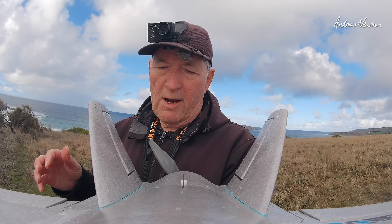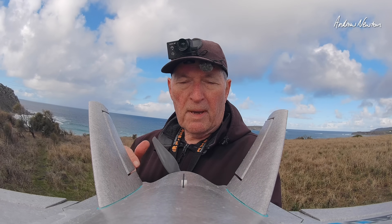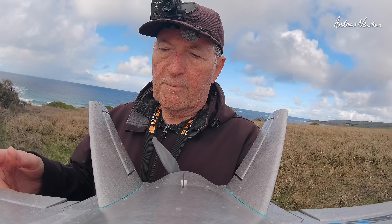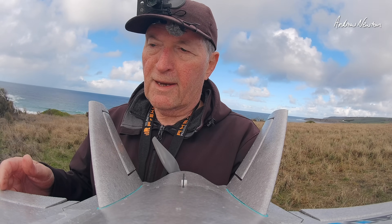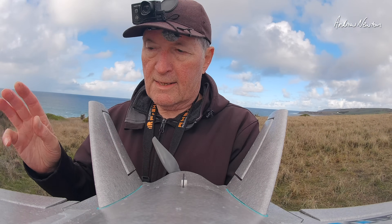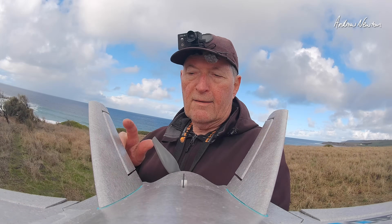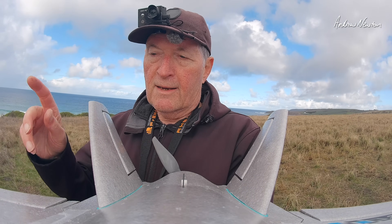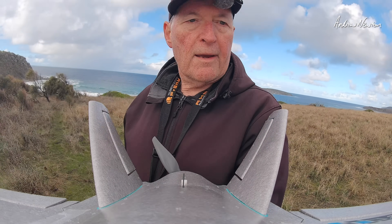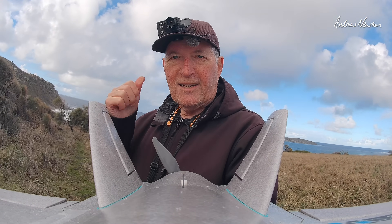That'll do it for the moment — that's gone very well. The adjustment to the thrust angle has worked very well; maybe just one washer would be better. 6s is better than 4s but it can fly on 4s. Pure elevons were okay but it needs a little bit more than the 50-50 mix — more elevator in the elevon mix. Pure V-tail was a very nice mix: 50% ailerons and 50% elevator on the tail. The mix of the two is also very good: elevons and V-tail elevator at 30% elevons and 30% V-tail. Both of those work very well — we're good to go. Put the FPV gear back on and we'll continue on. Thanks for watching, see you in the next video.